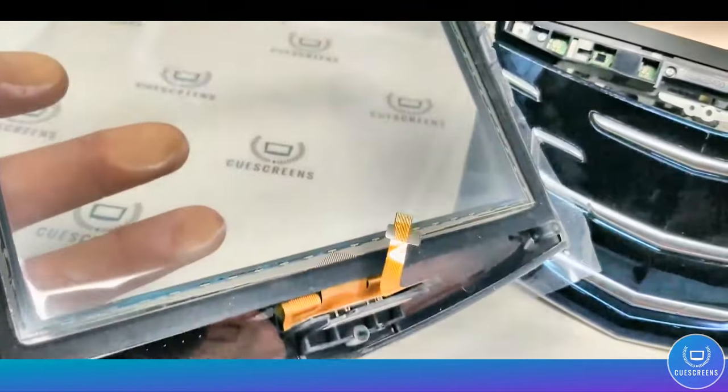The difficult parts are over — now we can move on to placing the compartment box back. Once oriented in the right position, align the slots, connectors, and tabs, and it will fit around the hinging door just like that. Get the black tabs in place and align the screw slots. Make sure the compartment box is all the way against the metal chassis — if it isn't fully seated it will stick out and cause issues with the door and power. Re-secure the seven plastic screws.